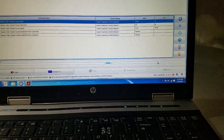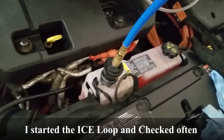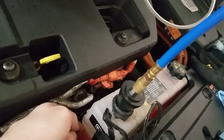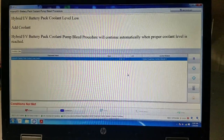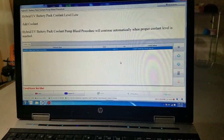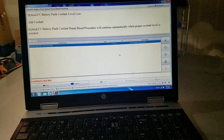The pump is running. It's nice having the wireless version so I can keep it connected upstairs while the procedure runs. About 3 minutes in: the initial level under vacuum was here, and it's already dropped — which means fluid has been displaced and some air came out. The vacuum has dropped a little too, as expected. My fluid level has gone low, meaning it's displaced some of the air inside there. I need to top it up and continue the procedure. Note: the wireless connection dropped communication with the module a couple of times — I wouldn't do module updates remotely; use USB for those.